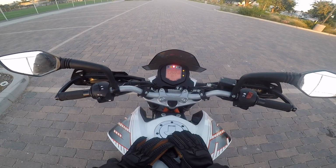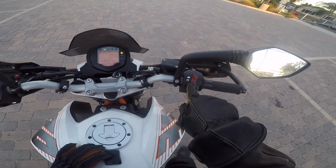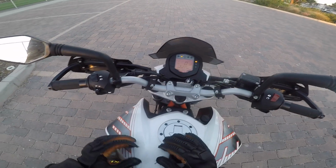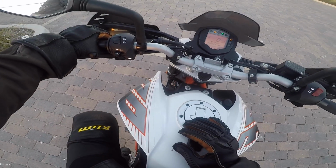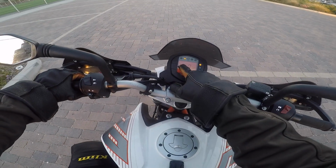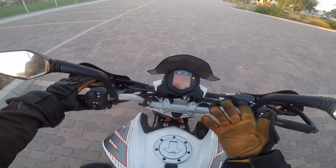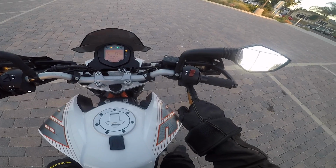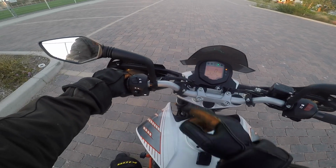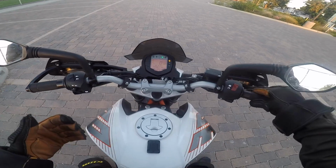Like I said, make sure all three things are good. My engine cutoff switch is in the down position, my key is on, my bike's not in neutral. So I pull in the clutch, I lift it up very softly. If you go too far, you see you're in second gear, third gear, second gear, just keep on messing with it. There you go, now you're in neutral. Once you're in neutral, pull the clutch all the way in, start it up. Since the bike's in neutral, I can let go of the clutch if I want to. I'm not going to go anywhere.